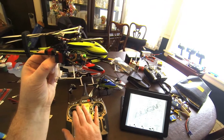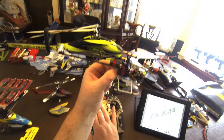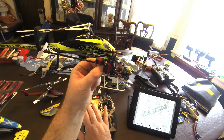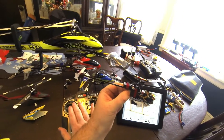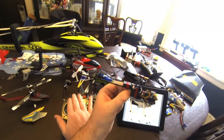Now it's going to give me two beeps, so I'm going to go low. Now I'm programming the electronic timing. It gives me one beep, two beeps, three beeps — that's high timing. I want to go back up, and it accepted that.